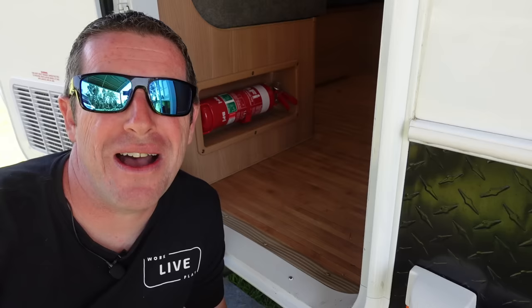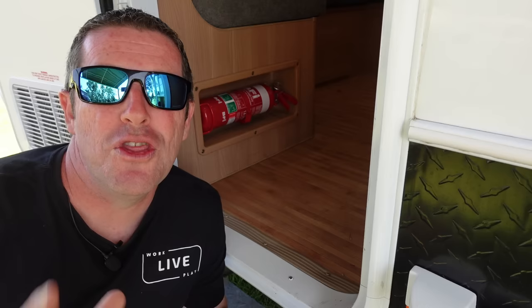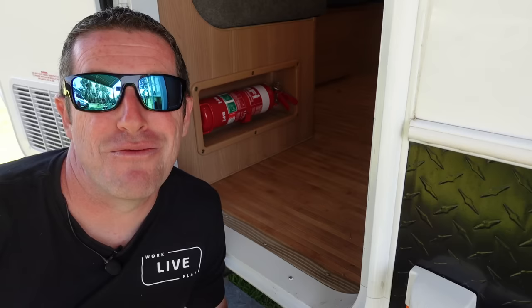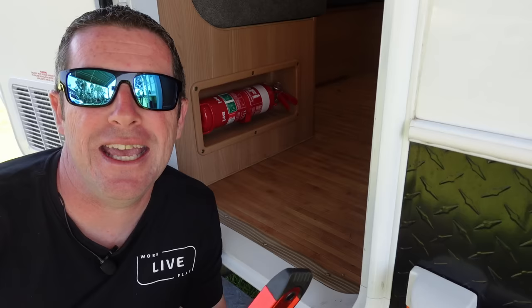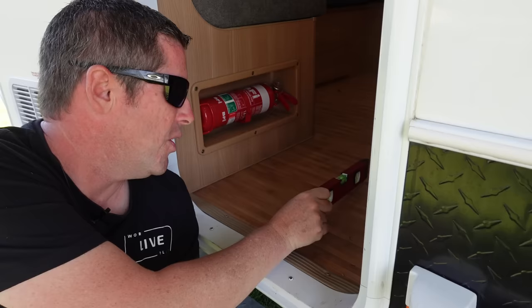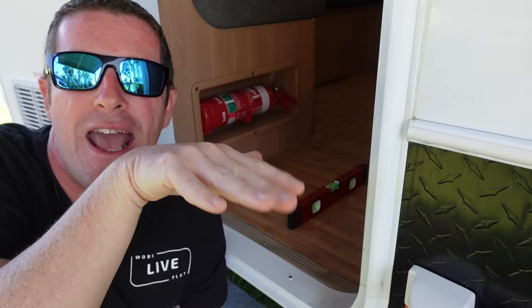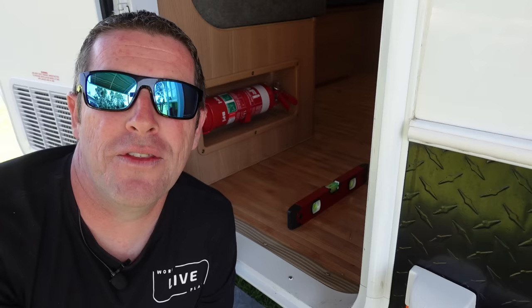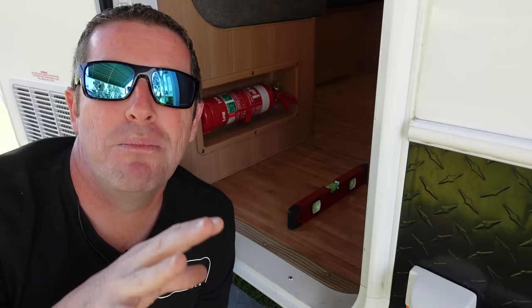Now that you've got your roof up, it's important to do the final levelling of the van. This is particularly important if you're running your fridge on gas — I did a video on that a few episodes ago for those not familiar with three-way fridges, with tips and tricks on how to get them set up and running perfectly. We carry around a little spirit level — it's fantastic. We've got a Jayco Swan so it sits in the buffet just inside the door. That allows you to run inside and outside, quickly check the bubble and make sure you're levelling the van both side to side and front to rear. Level the van front to back via the jockey wheel on the front, then adjust your stabilisers accordingly — you can tweak them just a little bit to get the level as close as you possibly can.